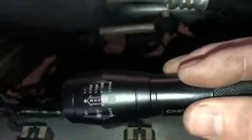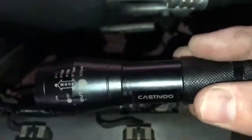But okay, basically the symptom we have is, here's your axle, which has been replaced, and here's the axle, right? My fingers are where it goes in. And basically what we've got is this housing here is vibrating like that, which is sending the vibration down towards the wheel here. So the vibration's coming here and it's causing that vibration like this. So it almost would make the sensation like you've got a warped rotor.